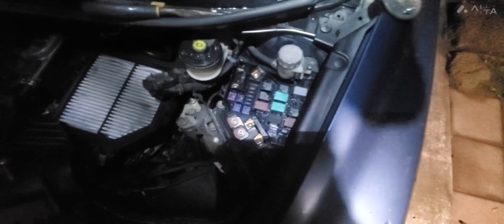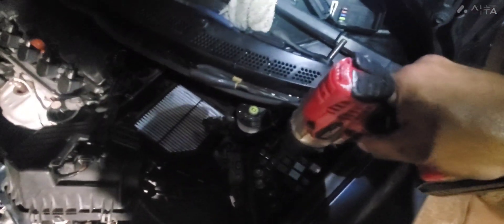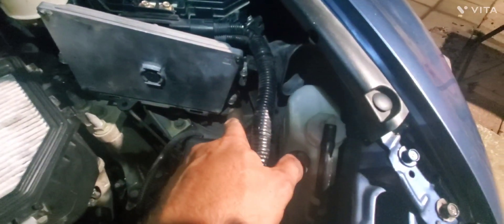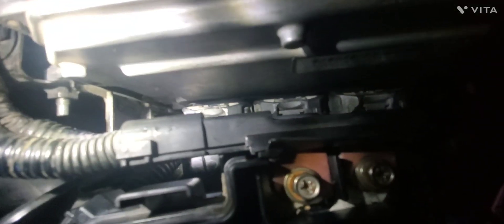When you put these back together, these screws — all these little screws — they're torqued in really high. So if you try to use a regular handheld screwdriver, you'll probably strip them. Push down on it real hard and reverse it. Those two are nine millimeters. As we put it back together, the ECU has three bolts — one there, one there, one there — and they're ten millimeter. When they snap in there's three clips, they're hinged at the bottom, so that top part will move to the driver's side where this fuse box is and then it'll push itself out. So you don't have to be rough with it.